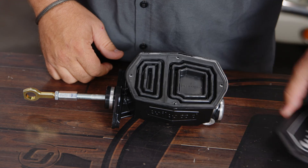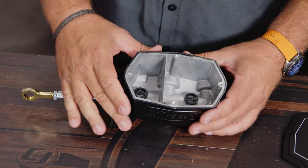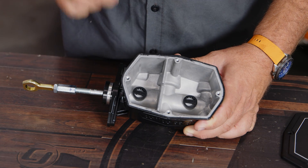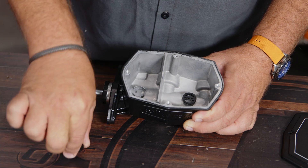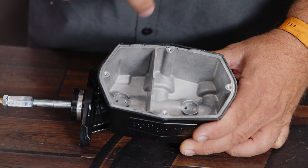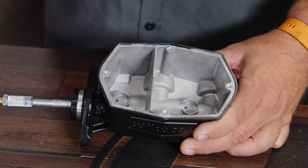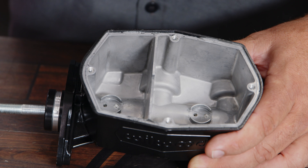Inside the cylinder itself, if you remove the cap and the seal, you'll see we have two chambers inside here. Basically, this is going to hold fluid, and then once that pressure comes in, you can see there are actually two tiny holes at the bottom. When the piston is pressed inside, fluid will come into these chambers, which are full of brake fluid, and push it through that small hole and out to your brake lines. You've got one part of the master cylinder for your front brakes and one part for your rear brakes.